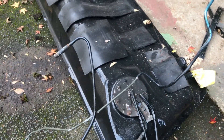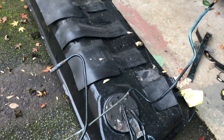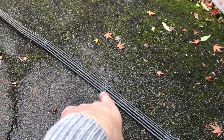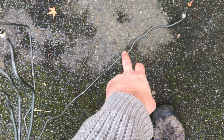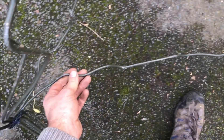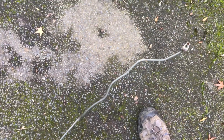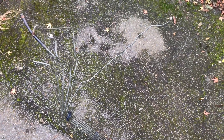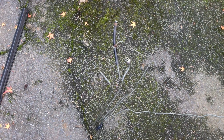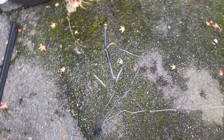These are all the pipes and hoses that connect to the fuel tank and I'm working out what needs to be connected before the tank goes in the car. Basically I don't think anything needs connecting first — it can go in and the pipes can go in afterwards. Some of the brackets are broken so I've ordered new little bars and plastic grid pieces. One of the lines at the front is a very strange shape — I'm guessing it was a real fight to get out and got bent into an interesting shape. I'll have to find pictures of similar ones to work out the correct shape. I think that one goes up to the master cylinder, and these ones went to the ABS, the fuel filter, and the fuel rail return.